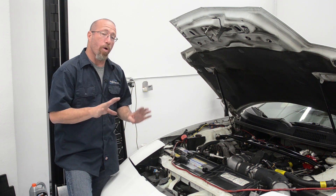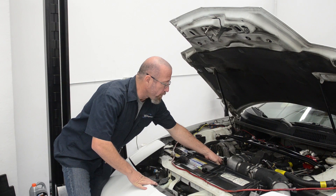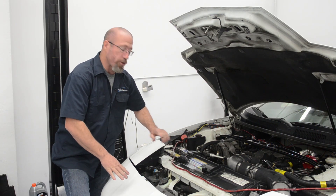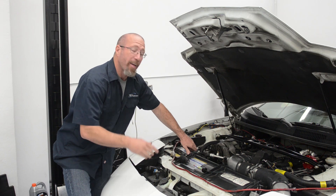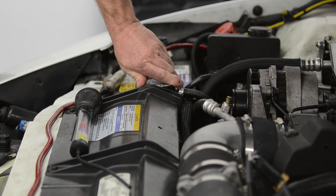How you test it is very simple. You want to make sure that there's no pressure in the system. The best time to do this is when the engine is cold. If you have run the system, just squeeze the upper radiator hose so you can see there's no pressure in there, and then go ahead and remove the radiator cap. If the engine is hot or there's pressure in the hose, be very careful when you remove the radiator cap.